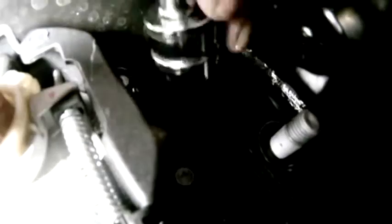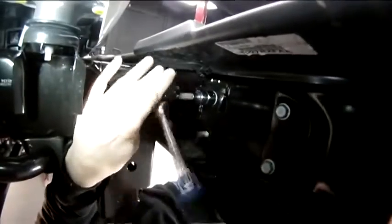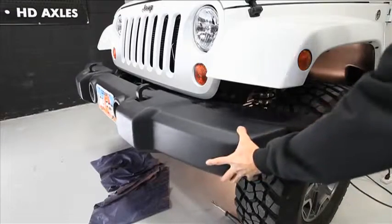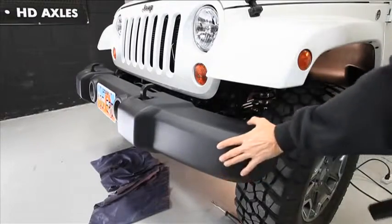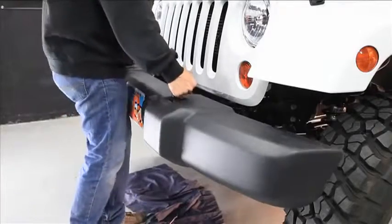Once the bumper nuts are removed from one side, slide that plastic cover back over to the other side to gain access to the remaining 4 nuts. Pull the bumper back a little and slide out the plastic frame cover. Go ahead and remove the bumper. If the reinforcing plates hit the floor, it's not a problem. They won't be used with the new bumper.